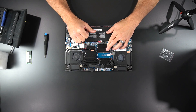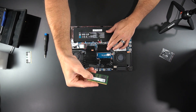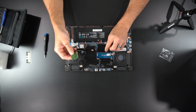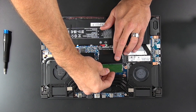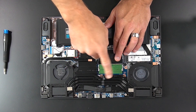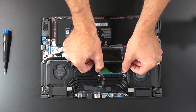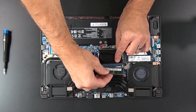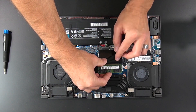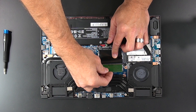Underneath here: DDR5. Move this up and out of the way. The slots on DDR5 are just barely off-center — just ever so slightly — so that means it can only go in one way. Make sure that's seated all the way and it clicks down with a nice, satisfying click. To remove it, these little metal tabs are going to lift out — it's spring-loaded, it pops up, and then slide it out. If you try to install it the other way, it looks like it could fit, but it doesn't. The DDR SODIMM is shifted over to the right — it's just not going to work. So you want to make sure the orientation is perfect.